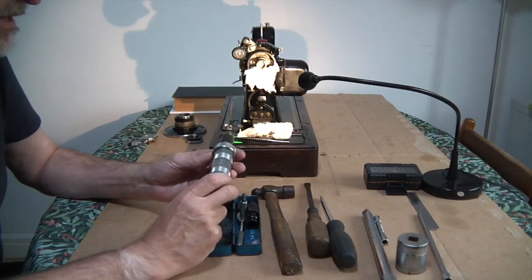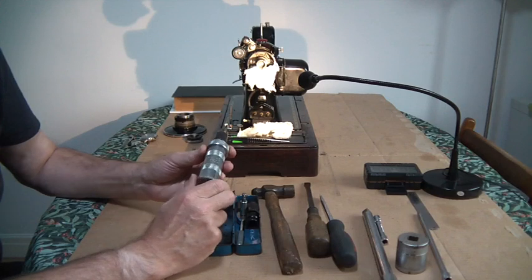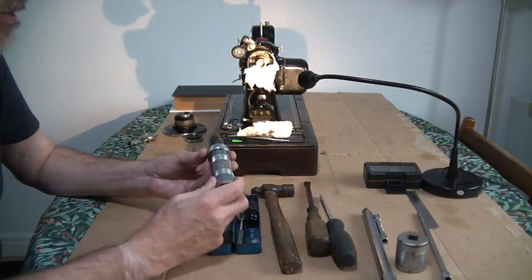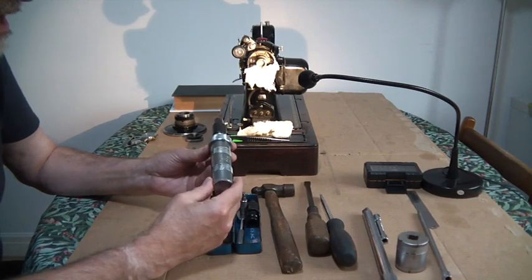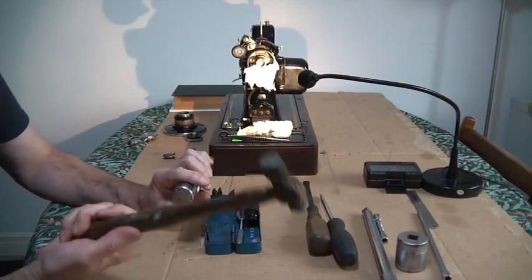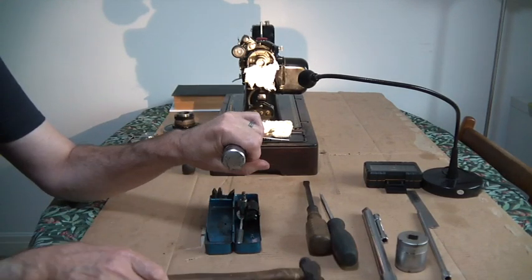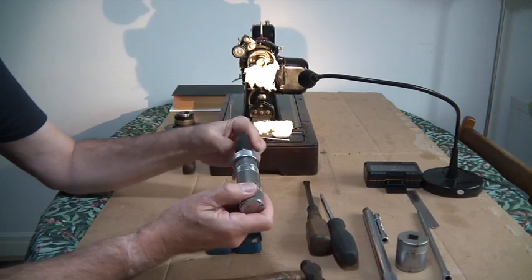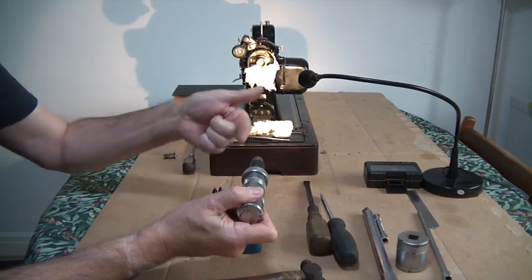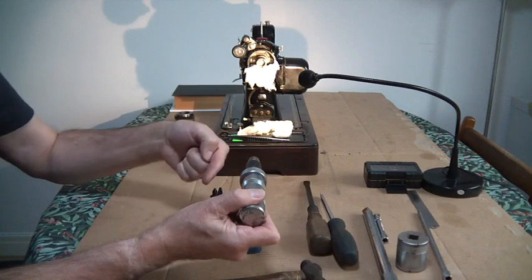And I used to use it all the time at one time for very big things, big engines, braking systems, things like that, anything mechanical. And the way it works is that when you strike it with a hammer, and this is only a small hammer, I used to use a very large one for this, there's a big spring in here and a few other mechanisms as well. And the force, instead of going down the actual screwdriver, is turned into a rotational force.